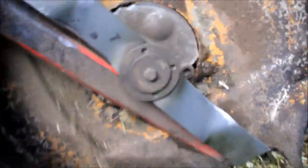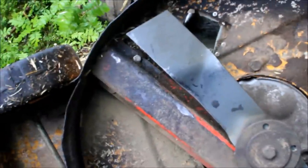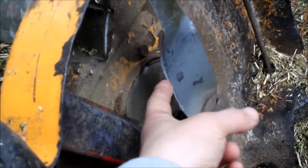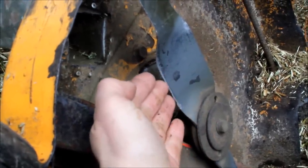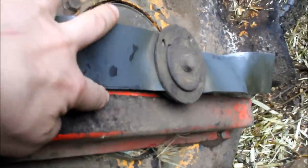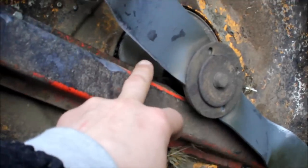And perhaps there's also significance for what kind of blade you have. You see, this blade has this part that, let me try a different angle, that outer edge is cutting along the ground, and the edge near the center of the blade is cutting downwards. And I also added this bar here, so the edge of the blade is cutting against that bar, like so. So I have to feed the branches towards the center of the machine.